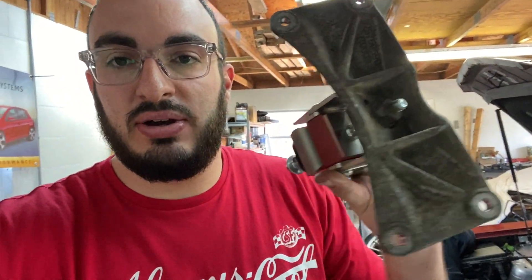I'm going to wrap up the video here. The next video will probably cover the subframe bushing process - I want to get one side done off camera and then film the driver side. I'll also paint these engine mount brackets up to make the engine bay look clean and get it 100% ready so when the clutch situation is sorted we can just throw it together. For anyone planning to drift or road race their CTS-V, I'd recommend an oil pan baffle - even with a rear sump you can still run into oil starvation at higher g-forces. Thanks for watching, like, subscribe, drop a comment, and I'll see you in the next one.